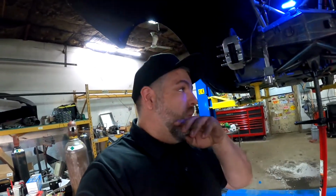That's because on a big tire, there's no exact deal on here, but this is going to be a generality when I say this. So before you fry me on the internet, this is a generality. On a big tire or a floppy tire type of a deal, you want more of the shock shaft showing so it can compress down on there. On a radial, you want less of the shock shaft showing because it's going to extend, okay? And that's why our shock mounts change on here.